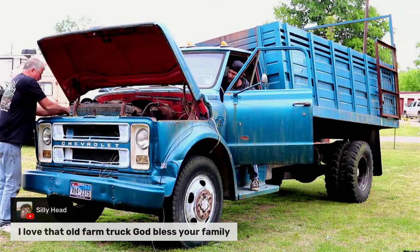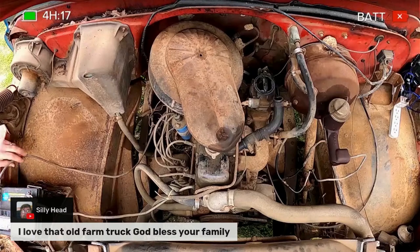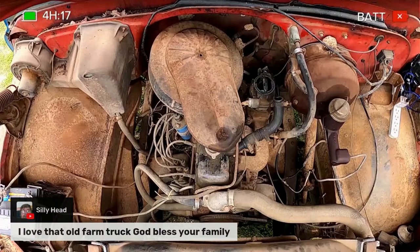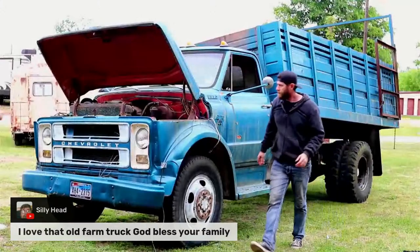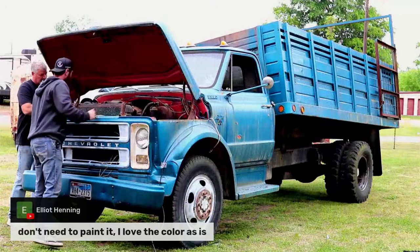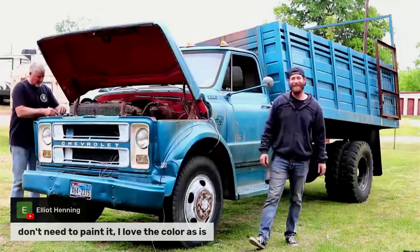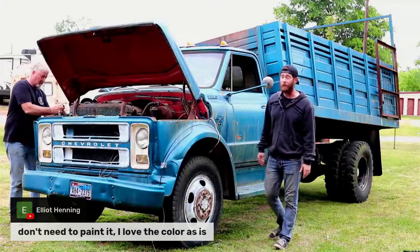Bad connection. It could be, yeah. Try it again. No. Yeah. Is it on the battery or at the start? I think it's the connectors. Let's give it a good cleaning here real quick. On the cables? Yeah. Just getting a little click. The gauges on the inside were actually coming on and stuff though. And yeah, there is fuel in it. The fuel gauge is working, so.